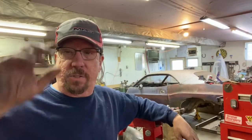Okay, so had a little challenge getting the timing gear on the camshaft. It's a pressed fit, but we were able to get it on there, and everything is good now. The camshaft end play is good, so we're fixing to put the lifters now into the lifter galleys and get those tightened down, and then we'll start assembling the valves. So we'll take you over there and just let you see where we're at.